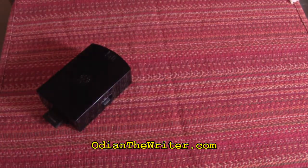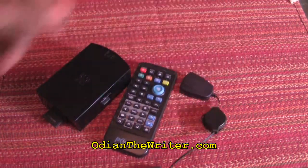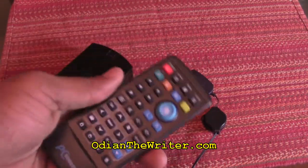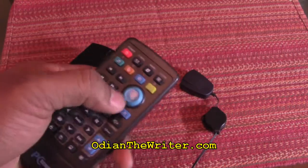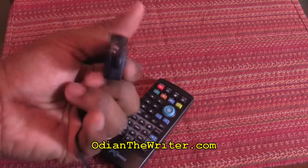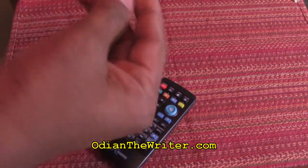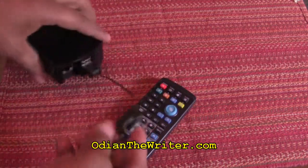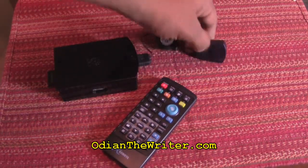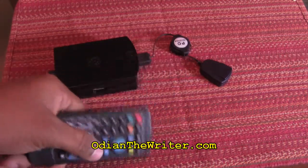But you could also do what I did with this particular hack. I got one of these — it's actually a PC remote that has a little scroll wheel for using your mouse, left click, right click. It's compact and easy to use. This is the little USB receiver for it. You just plug the receiver into the USB slot — done, no configuring. Raspberry Pi already knows what the device is. It takes about 30 seconds to a minute for the machine to come up, but once it comes up this should work just fine. This ran me about eight bucks.